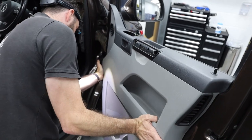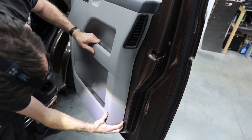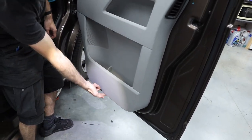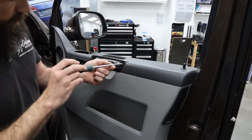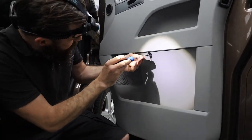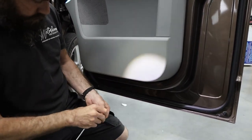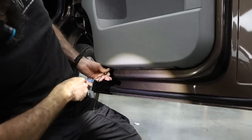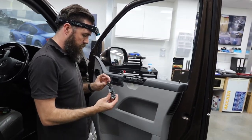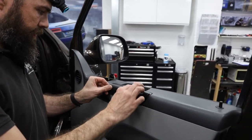Looking through the grab bar, make sure the two holes line up with the helicoil bolts on the door — this is where your two T30 bolts go, as pointed out now. Then put the screws back in the middle and bottom section. Step 30: two T30 bolts for the door handle, one T25 in the middle, and three T25s in the bottom of the door. Once all clips are pushed firmly home, pop the cover back on the little clip, push it home safely — that's it done.